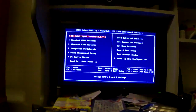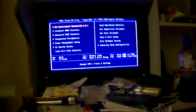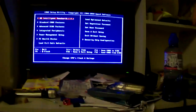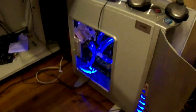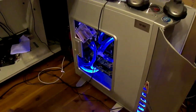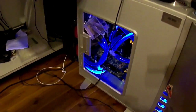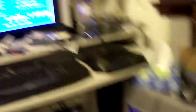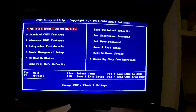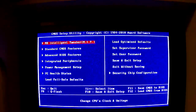Some things I've got to mention first: a very easy overclock will obviously depend on the chip — like depending on how lucky you are, what type of silicon lottery gem you got. Also the cooling you have — is it sufficient to make that 4 GHz overclock? Another factor is the motherboard, the RAM, stuff like that. Every chip is different, so only take my settings as a guide.